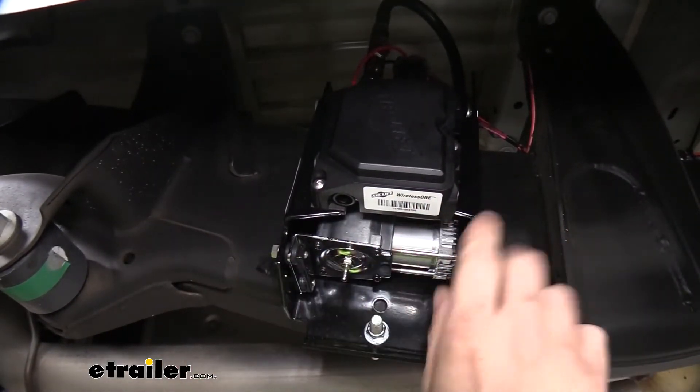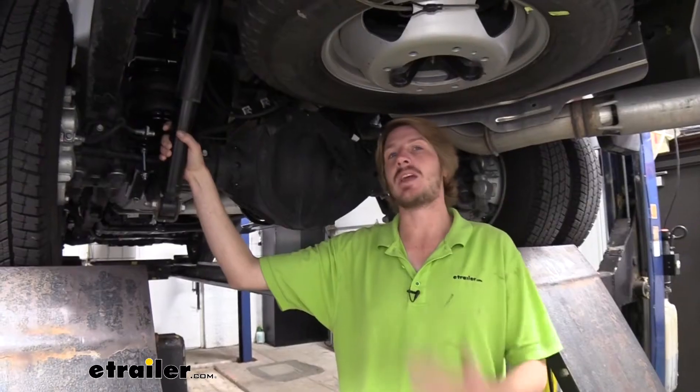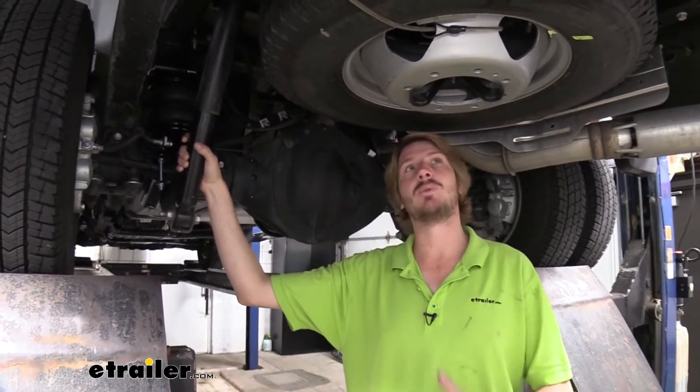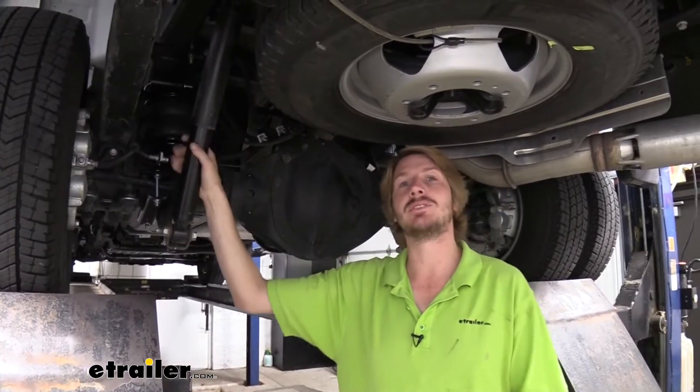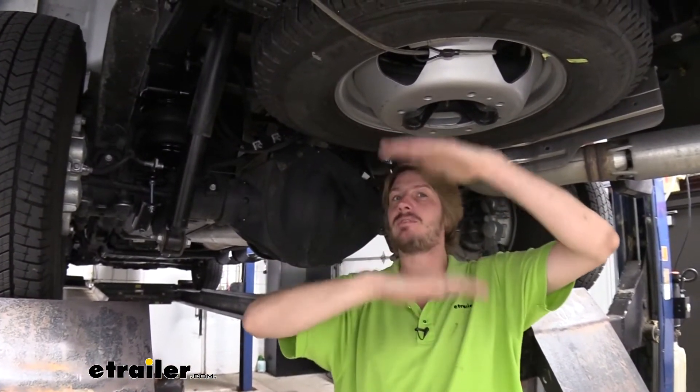So you could pull up to a place and have somebody drop a pallet in the back of your truck, adjust the pressure on your phone and take off. The operating range of our bags is between 5 and 100 PSI. 5 pounds is when we're just normal driving around, completely unloaded. It is important to have 5 pounds in there because as your suspension moves up and down, it can create a small vacuum in there if you don't have any pressure.